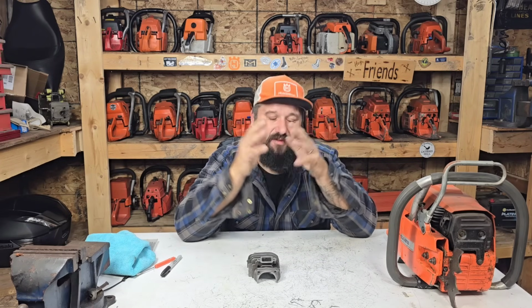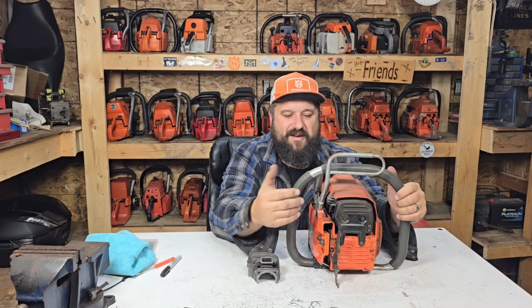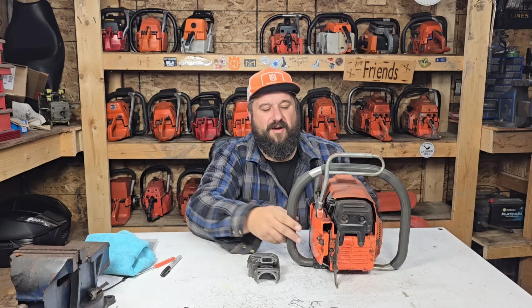Now, the question is, what caused that? Doug sent me another email, and I said, you know what, Doug, I'm going to make a video on this and I'll show you my thoughts on it. You see the chip on there. That chip is on the hot side. The hot side, friends, is this side, okay? Often if you're going to score a cylinder on the exhaust side, you're going to score it on this side of the exhaust port. So if you're at the back of the saw like this, the right.